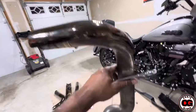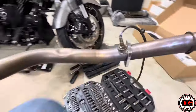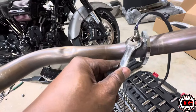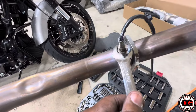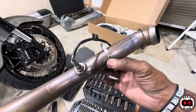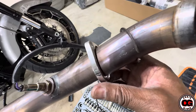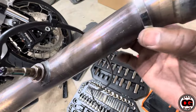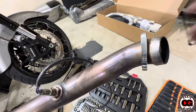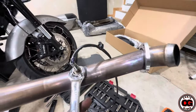You really can just leave this pipe on — you don't even have to loosen that part right there. I'm just going to use my 11/16 and get these sensors out. You just take them out just like that. You're also going to have to remove this clamp here. See how this goes — see how that has the cutout on the inside? That is going to fit right in there like that. So we're going to be taking these off and putting them on the new set. When I come back I'll have all this stuff taken off.